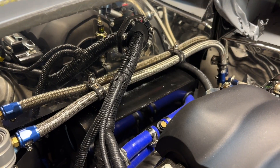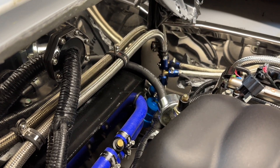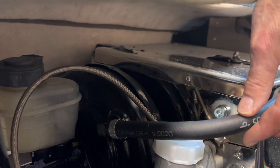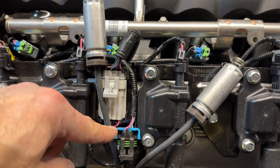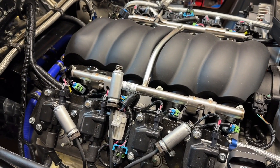I've got my Trigger Handbrakes grommet in there — really nice, holding that dead in the centre so no chafing. I also tidied up the fuel line, got the correct size end trimmed for the hose — all nice and neat. I've temporarily put in the vacuum hose for the servo — it comes out the back of the engine, rests on top of my heater box, comes around, and goes into the servo. The O2 sensor going to the lambda is fine, but on the other side it's a little bit short — as mentioned by Canems — so I'll have to extend that in the next video.